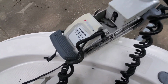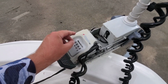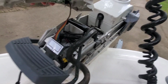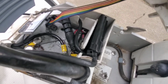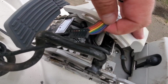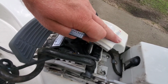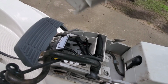And we're going to pull our wires back here. We're going to take the cover plate off just like this. You'll have a little set of wires down here connected, and those just slide off. See if I can get the camera there. See it kind of just sitting there. You're going to take these and pull these up, and they just slide right out. You see, that's a 7-pin connector. Make sure you line those 7 pins back up the way they go.